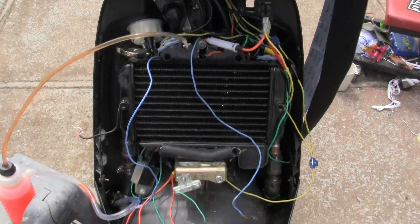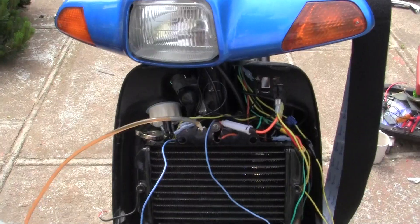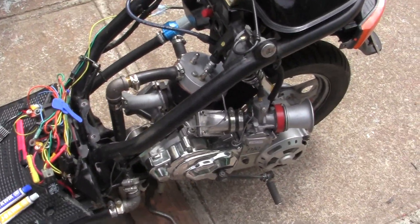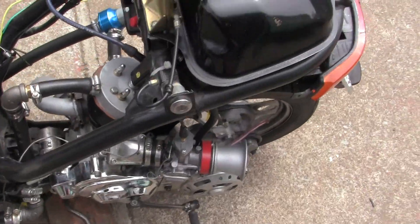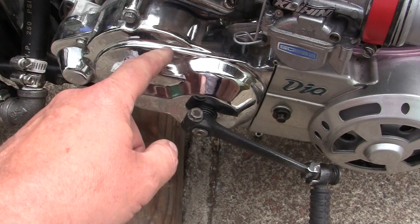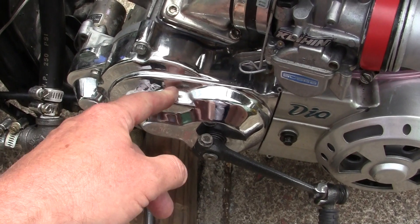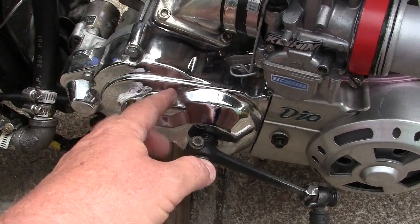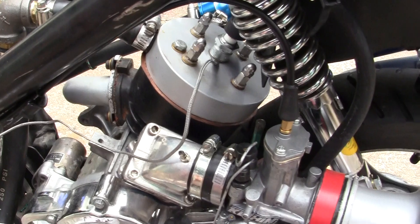The blinkers work. I've got to hook up my speedometer cable, adjust the brakes, adjust the throttle cable. I wanted to say I've got some new parts coming in. I've got what's called a gear lock — it's this cool thing by Motion Pro that fits in here and keeps the flywheel from spinning, I mean the starter gear from spinning. It's really neat looking, just a little tiny piece on a string of metal with a magnet on it. Then I've got a flywheel holder coming in from the same place.